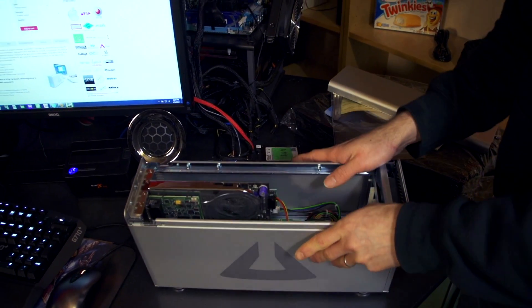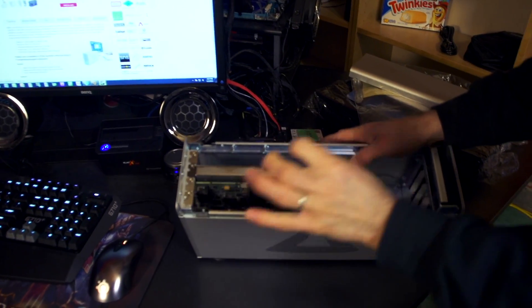I tried a bunch of different graphics cards — GeForce cards, Radeon cards, even a Quadro 6000 — but unfortunately on the Windows platform I wasn't able to leverage those. Out of the cards in here, the Blackmagic Intensity Pro worked flawlessly. So if you wanted a portable capture station, say with a powerful Ivy Bridge laptop with a Thunderbolt port, you could carry one of these around, run it off a small UPS, and do multiple camera captures or live-to-tape recording on set. You could install three of those cards and capture up to three sources at the same time.